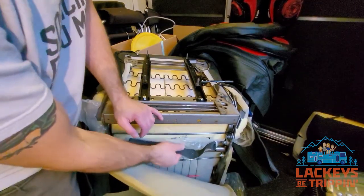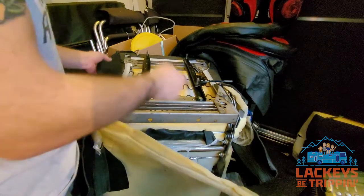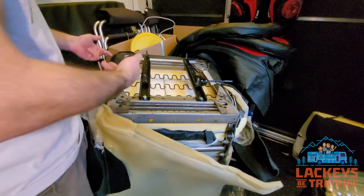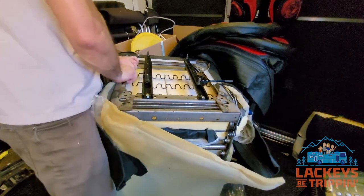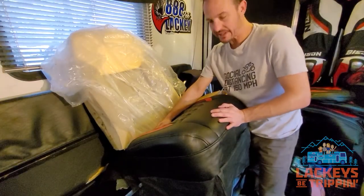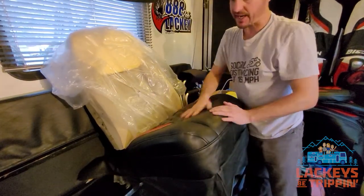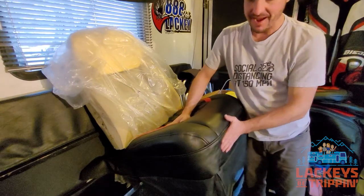This is the back of the seat — I need to pull this flap over and this is where I'll apply the first hog rings as I wrap it around. First I'm going to flip the seat to make sure everything's where it needs to be. We have a little bit of a fitment issue — the J hooks aren't quite in the right spot. I hope that's just the positioning of where the J hooks are sewn on as opposed to the seat cover actually being the wrong shape. I'm going to give it some tugs and cinch those back flaps.